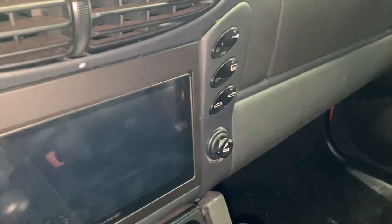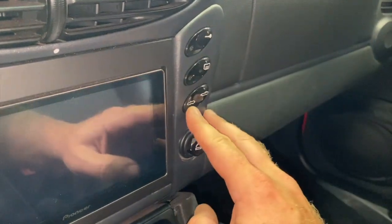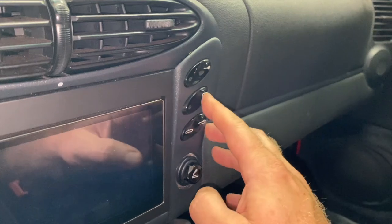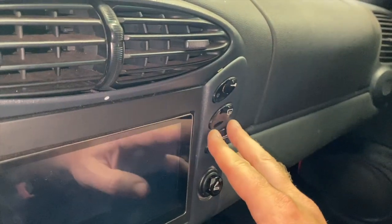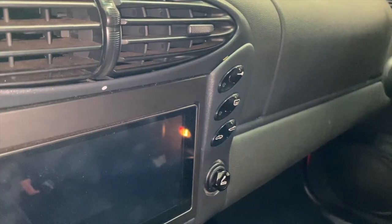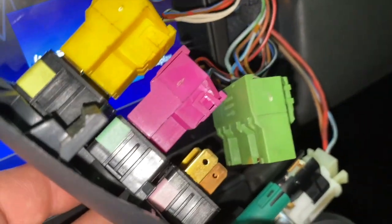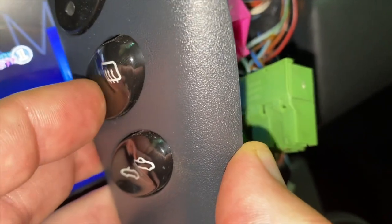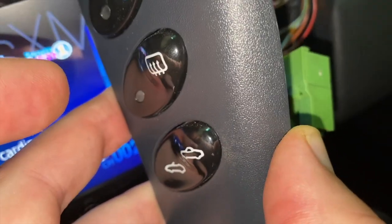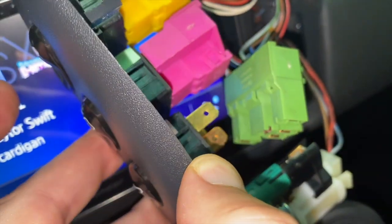All right, let's see. Another troubleshooting step that I just thought of is that all of these buttons should actually be identical in working. So I figured maybe I would take one that I know is working and swap it here real quick just to see if that matters. Pull one that goes to my top and moved it up to the green one. And I can confirm that does not help. So that can eliminate the switch from being the problem.